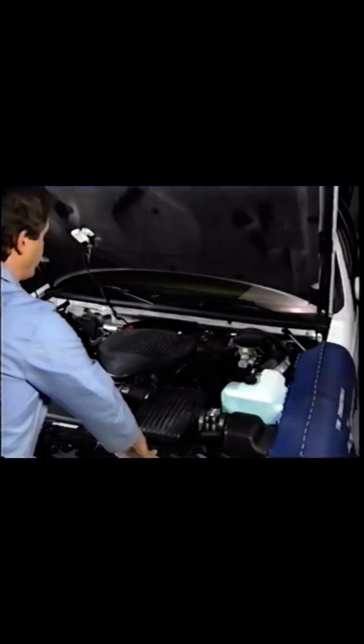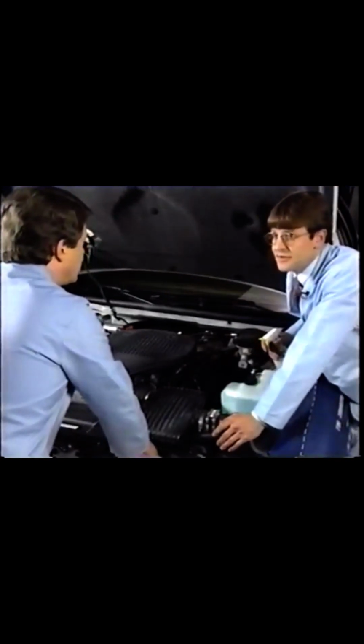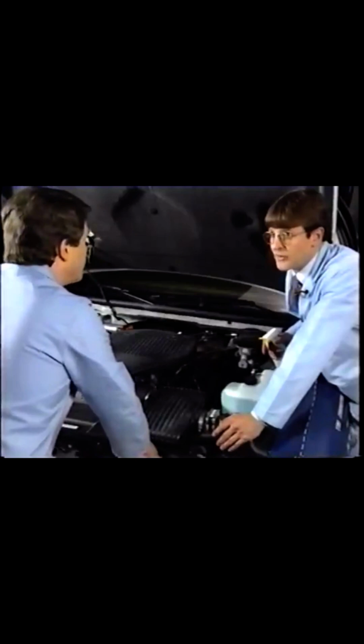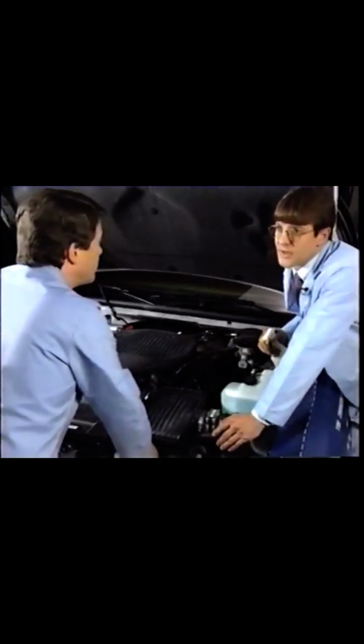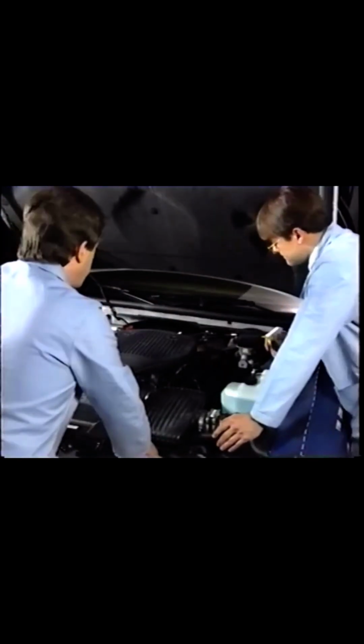I'll show you how to check for misfires. Misfires may be intermittent in that they appear only when the engine is under a load. Misfires are also usually due to a spark plug or secondary wire that is leaking high voltage. If the engine misfires only under a load, mist the wires with water from a vegetable sprayer like this. Spark that is escaping from the secondary circuit usually can be seen under these conditions. This one seems okay.